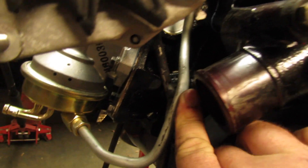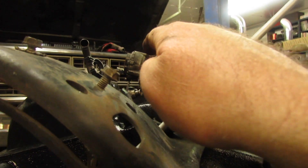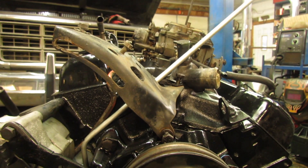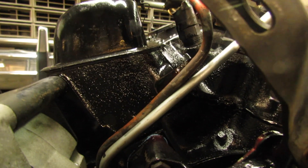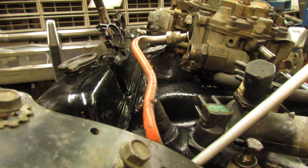We're coming up - missing the radiator hose, it's a little tight right there, probably have to tweak that just a scotch. We're looking good there and now right there I need to bend it about 45 degrees so it gets vertical again, then I'll need to bend it back that way. This is not a real exact science, at least I haven't mastered it to that degree yet. I changed my mind - if you line up that puts me almost directly in line with the fuel inlet. I think I'll be better off to make the bend so it goes vertical between the heater hose nipple and the valve cover, which will give me more room to get into the carburetor. I'm going to deviate from the original design slightly.